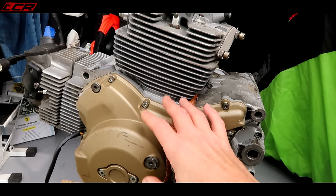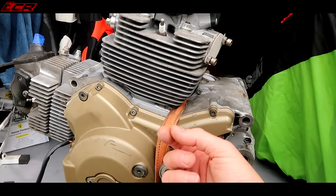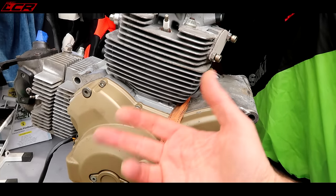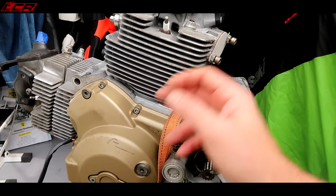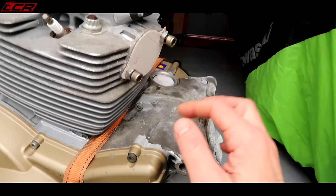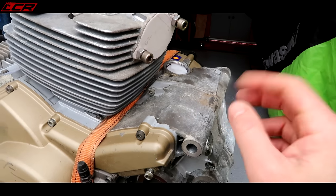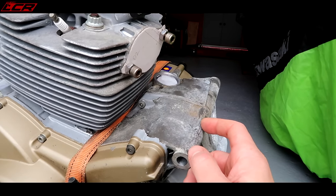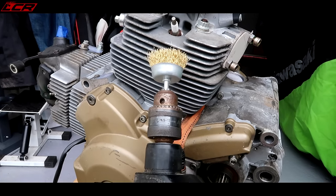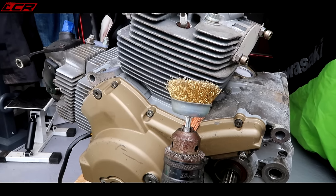Not when an engine's assembled like this, you can't do bead blasting. But CO2 blasting uses bits of ice blasted at the engine — they just melt and rebound off the bike. If they do get in, it's just a little bit of water which will just evaporate. So that was an option, but it's very expensive and very specialised. You can rent machines, but it's not practical. So what am I going to do? I'm going to try just with my trusty drill and some wire brushes and see what we do.